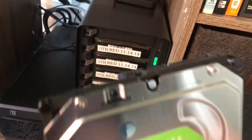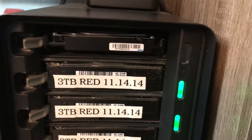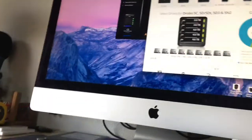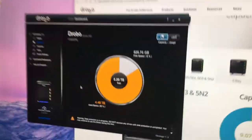I have taken out the three terabyte drive and as you can see the lights are going crazy — it's not happy with what's going on. I'm going to take the new drive and slide it in until it clicks. Okay, now I can hear them all moving.